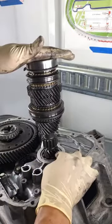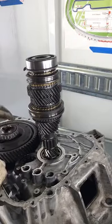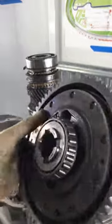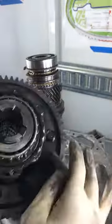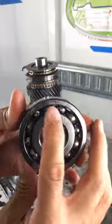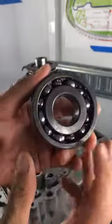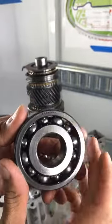There's one on the top of the main shaft, one at the bottom of the main shaft, and then the same thing for the counter shaft. There are also two other bearings in the diff over here. To pull the diff out, you just kind of grab it out like this — you can see the diff, and there are two taper bearings on it, one on each side. And then this is the final drive right here. The bearings are about 70 bucks a piece. You don't have to buy them from Honda — as long as you take down the numbers on the bearings, you can get them elsewhere. This one is an NTN bearing — you can see the NTN right here and there's a part number right there.